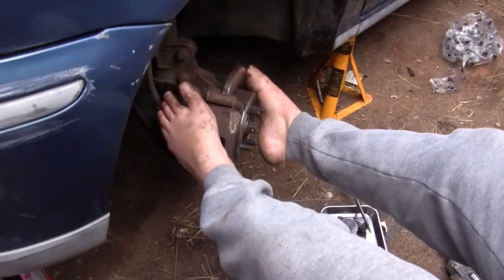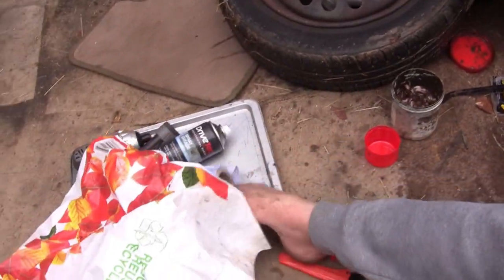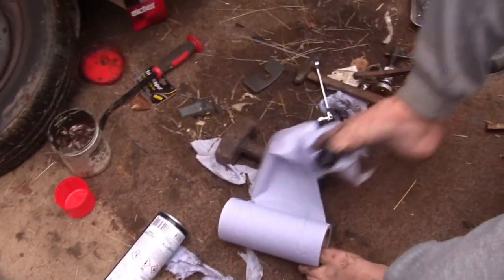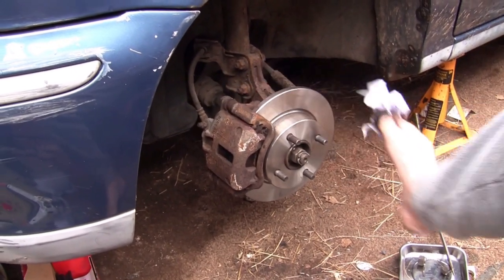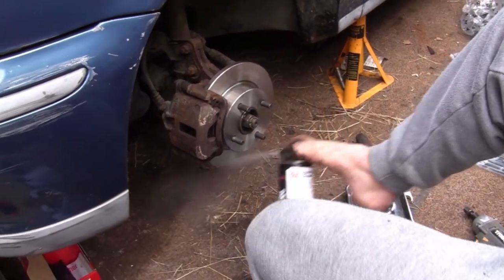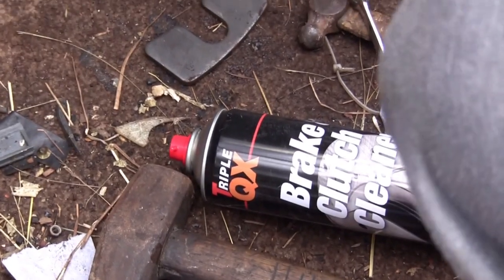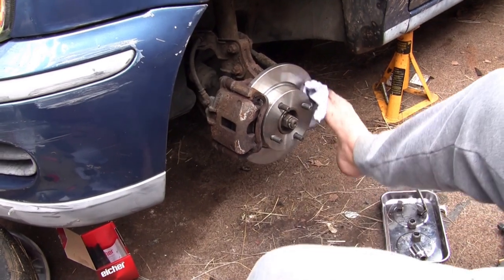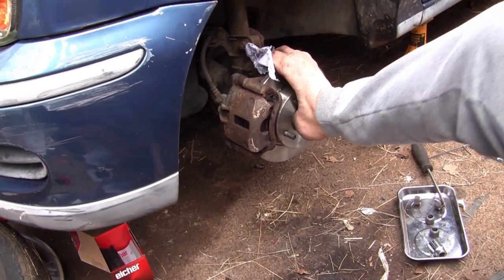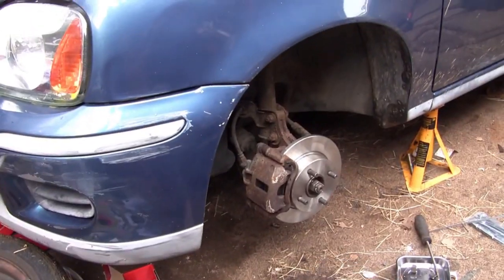Now I want to give it a good bit more of a clean. Always close your eyes when you blow. Clean tissue, no grease. Dust the crap off and we'll get a little bit of brake cleaner again. Now there's no grease on there. The little old boy won't be going down the road, putting his foot on the brake and finding he can't stop. The car's in park so you can't turn that. So now we just put the wheel back on. I've got to check the brake fluid and then do the other side.